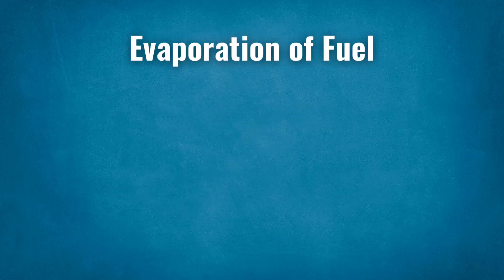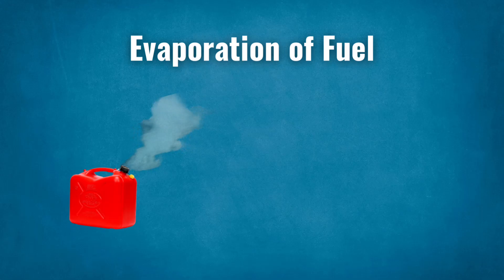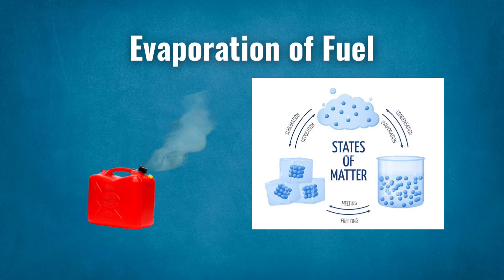The second reason is evaporation of fuel. If you've ever spilled fuel on your hand at a gas station or when refueling your aircraft, you'll already be aware of how quickly it evaporates — and it feels cold. Evaporation occurs when a liquid changes into a gas, and to do so, it requires energy. This energy is drawn from the ambient air or anything touching the liquid. Petroleum and kerosene both have weak intermolecular attractions, which simply means fuel evaporation happens more readily and quickly, with faster energy transfer. Fast energy transfer means faster temperature loss, and fast temperature loss means ice.